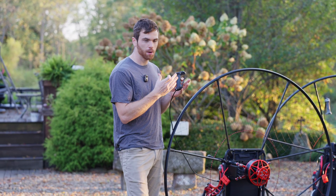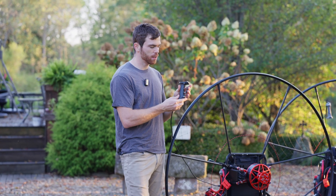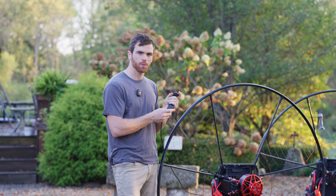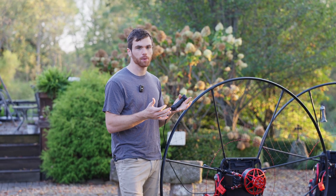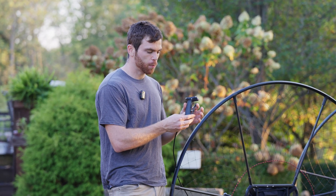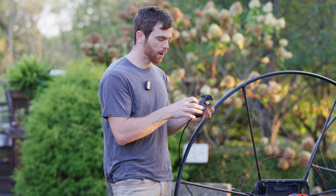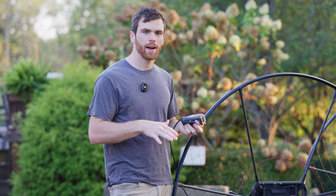A lot of people complained on the earlier versions that there wasn't enough throttle feedback — it's too easy to hit the throttle. I kind of like that, but a lot of people don't, and honestly I think the new system is a lot better for those people. Now there's a lot more resistance; it's more like a gas motor where it's harder to press the throttle. And also we did some refinement of the motor control, so it's smoother. Chill mode is more relaxed, so overall it's a lot less super responsive — you want it responsive, but not super responsive. So this is dialed back physically and in software at the same time.